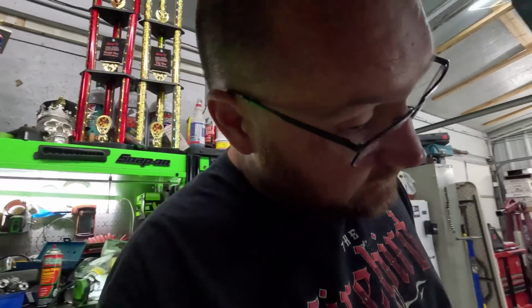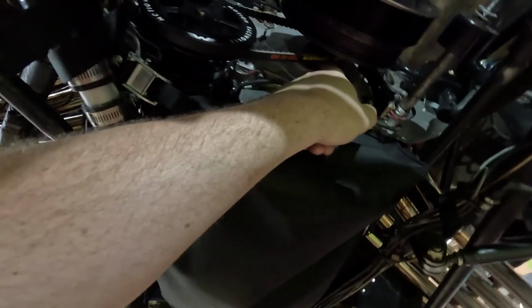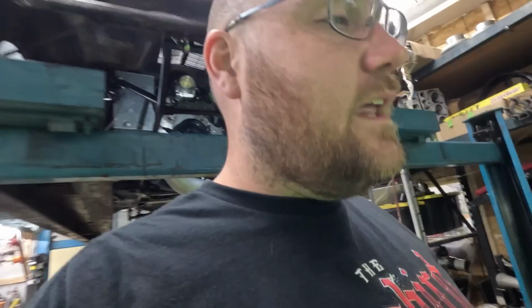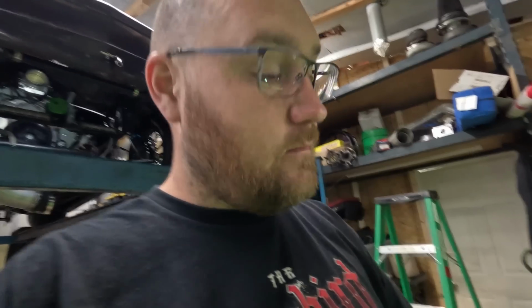These toothed belts are pretty good about following the same path all the time, especially if you have a walled pulley. If you've got a walled pulley, it doesn't ever move. So to me, it doesn't really need to be there. I'd rather just have everything be thicker. Well, what I think has happened is that hub is now wobbling.